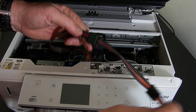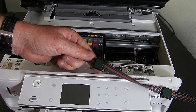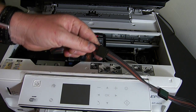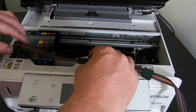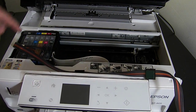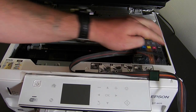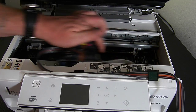Part way down the incline you see this green sticker — you need to remove the green backing tape from that. You can use a pair of scissors or nails if you've got them, or anything sharp. Before you affix this, slide it all the way over to the left-hand side, then affix it in the middle so there is a tiny bit of slack. You can adjust it by pulling the cable through, then manually slide it to the right and back to the left a couple of times to make sure there's no twisting or snagging.